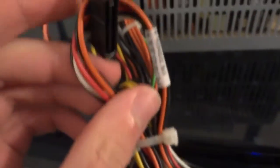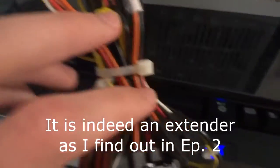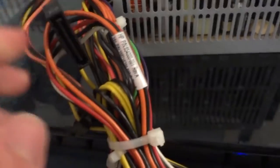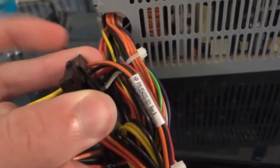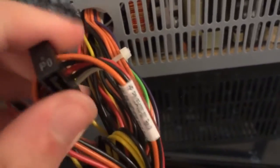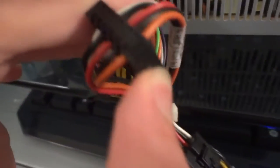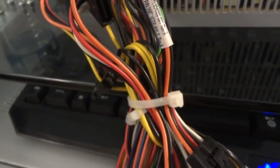This part here is actually what I think is an extender — so if you plug that part in, it gives you an additional SATA connection; it's like an extension cord. So I should be able to modify this extension cable and all will be good. If it's not, then I'll just pop in the other power supply, which does have a dedicated Molex.